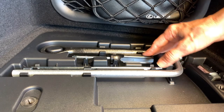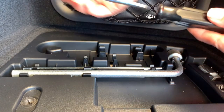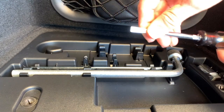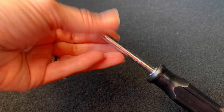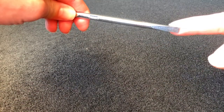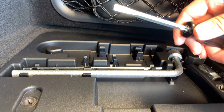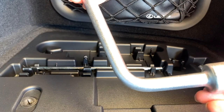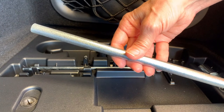In case you have to tow your GS in an emergency, remove the towing eyelet and remove the screwdriver. Flip it around to the flat head screwdriver side. If your screwdriver is stored with the Phillips head portion showing, just pull it apart — you have a flat head screwdriver on the other side. Insert the Phillips head side and slot it into place. You'll also need a tire iron or heavy pipe to fit into the eyelet hole to tighten it down for emergency towing.